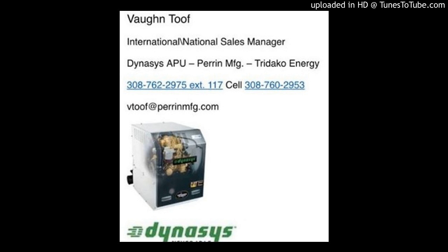It says on your website that the fuel savings are one gallon per hour while idling — how is that possible? The truck I have, a '94 Peterbilt, burns about 1.4 gallons per hour. The APU unit itself under full load burns less than 0.3. So that's over a gallon savings on my truck. Every truck varies, but most trucks burn over a gallon to a gallon and a half an hour — that's what we're basing it off of.